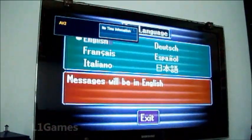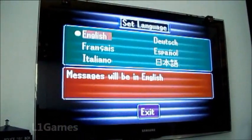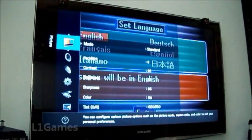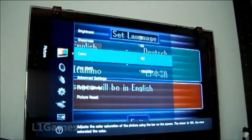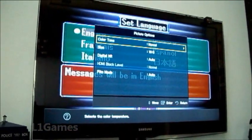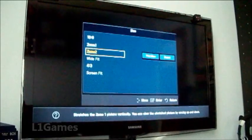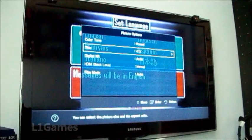As far as I know, every TV has the option to change this. So real quick, I'm just going to show you — grab your remote. It might be a little different from TV to TV, but on this TV I just hit menu, go into my mode, scroll down to picture options, and right in here you're going to have your size. You can zoom, it just depends on your TV, but it has the 4:3 aspect ratio and that's it.